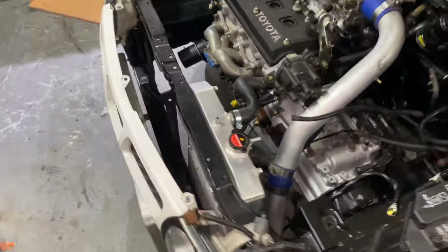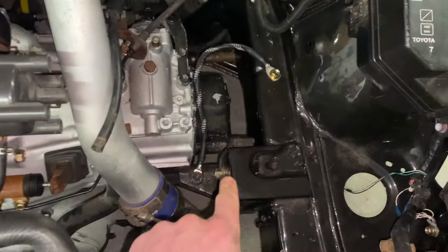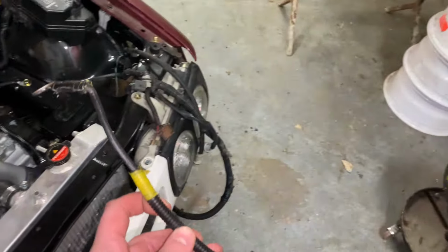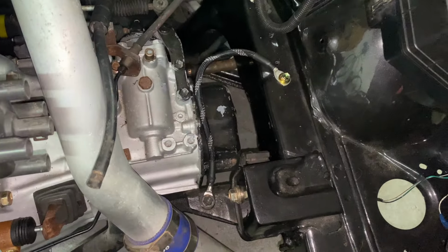I then, after having a little bit of a trial, remade this earth cable. So this is a new freshly made cable which replaces this old kind of fairly ugly looking one, and that also was included in it. So my negative battery terminal was on that. So this is the new piece. Still haven't done anything on this side of it, so I used the little earthing kit as a trial before I went cutting any of the big power cable for the rest of the kit, just to see how it works, how to do the sleeving, all of that kind of stuff.